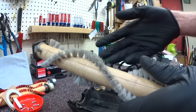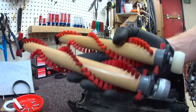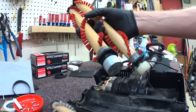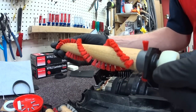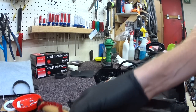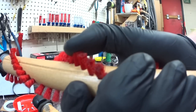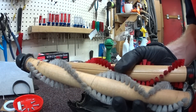Oreck brush rollers are made to be changed every two to four years — they are a wear item. I have here some new Oreck brush rollers to explain the difference: one without a metal pulley and one with a metal pulley. The plastic pulley has a magnet in it for the lifetime belt sensor, so that's a whole separate part number for a different vacuum. This one is going to take the metal pulley brush roller, which is for the rubber belt model like this.